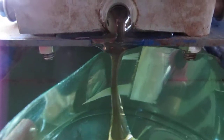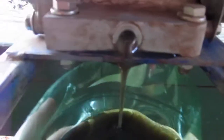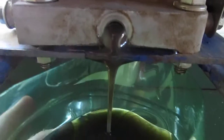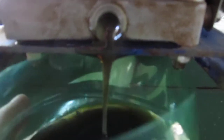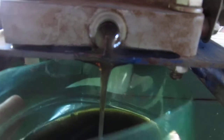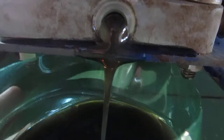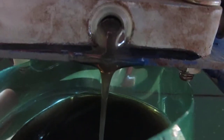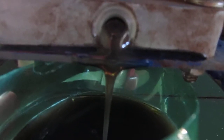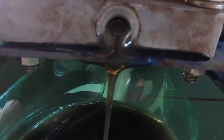This is why it's important to run a break-in oil as well. This was just straight AutoZone 30 weight SAE non-detergent. I believe I used one fluid ounce of Lucas ZDDP engine break-in per pint, and the oil capacity is a pint.